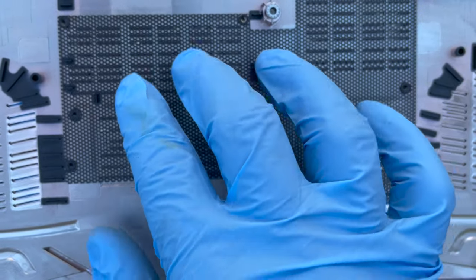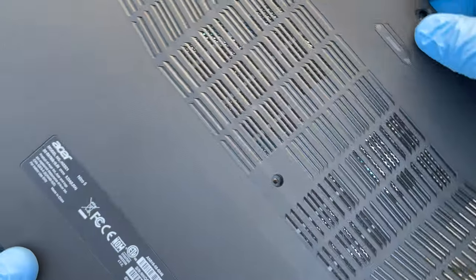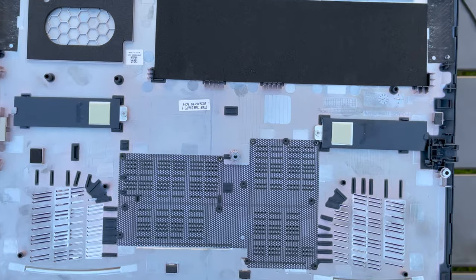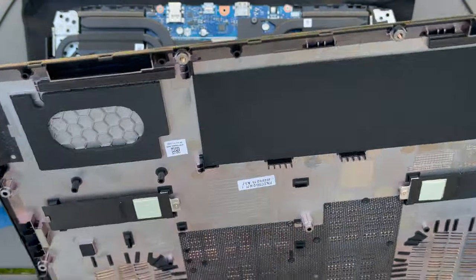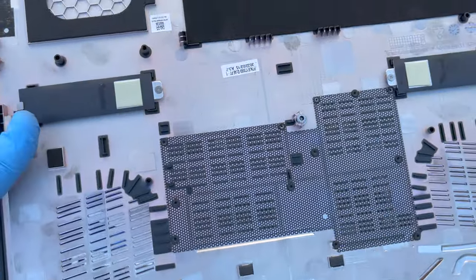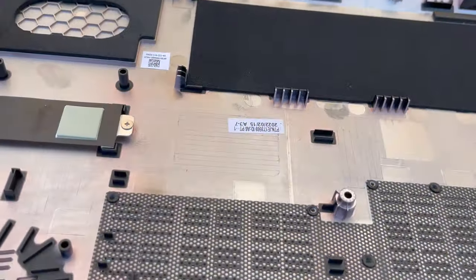The mesh grill is located above the CPU, GPU only, and it's not implemented over the fans. This will help not to restrict airflow, but on the other hand, it will allow larger particles of dust, paper, etc. to get inside your machine. I'm not going to be too harsh about this, as I bet this is from many complaints of hot CPUs and the machine not being able to cool itself properly.